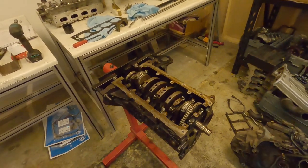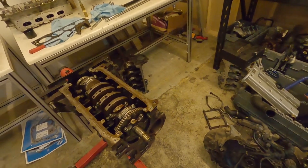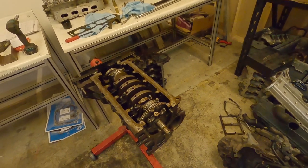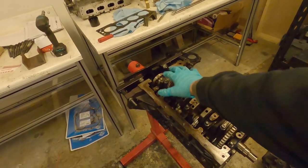It's all been re-washed again. All the gallery plugs have been removed. We've blasted air through and a lot of cleaning fluids through it, just to get any possible contamination out of the block and out of the crank. Then everything's been popped back in — pistons all in the same cylinders, crank's in, all bolts currently just finger-tight.